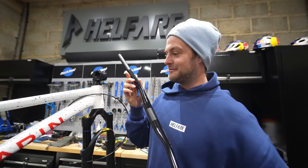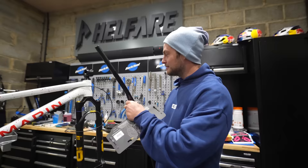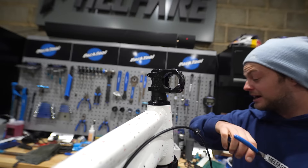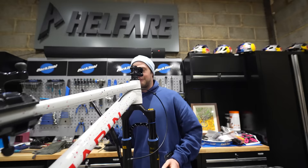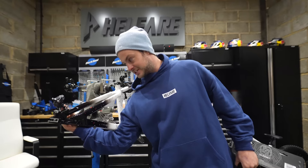You won't even be able to get between two trees! I run mine insanely narrow — like 725mm — which anyone who rides my bike detests. The stem's 33mm long, which is very short. The brake is a Shimano XT one. Four pistons for superior pump track stoppage and dirt jump deceleration, and a very, very nice lever to match. It's all kind of colour matched with the titanium.